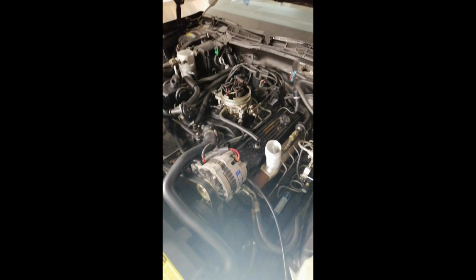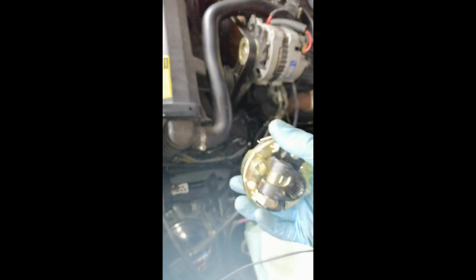And in order to mount that and to get to the steering shaft, I had to take the intake out. After that, you just have to lift this plastic cover up and pull back. And here's the old steering coupling. So this is where I'm going to release that nut, the one that's here, 13mm.